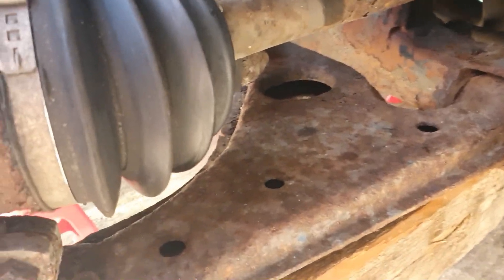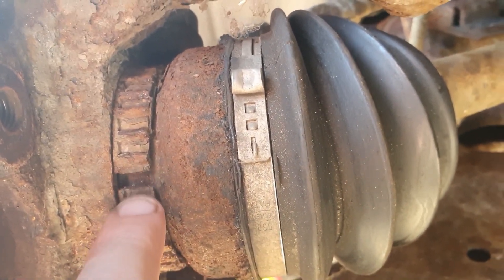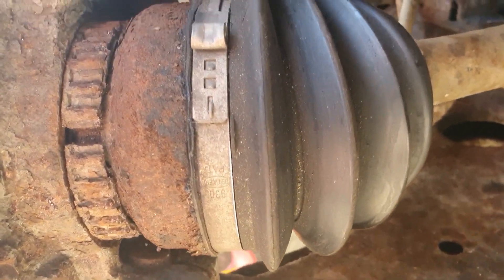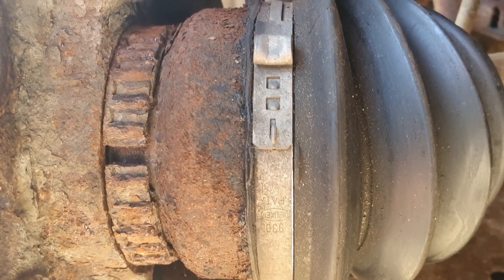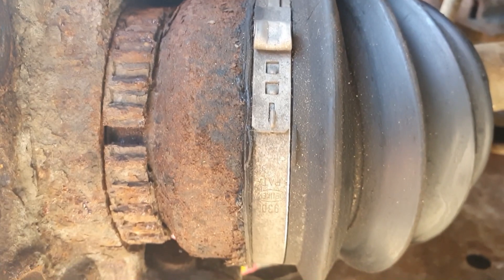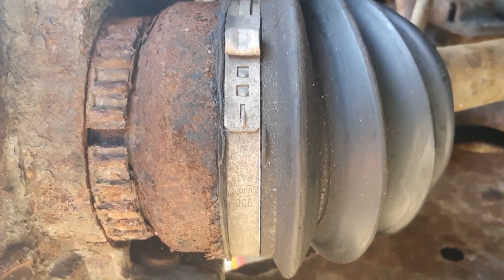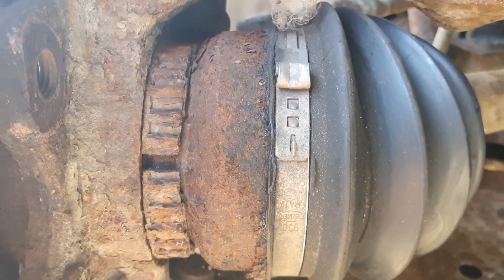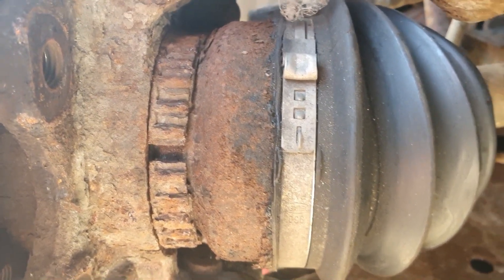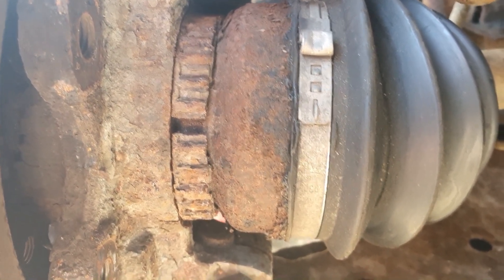I've just spotted another problem. If we look right in there, this ring here has got what looks like a bit of a cog. That's a wheel speed sensor — it detects those cog-like teeth as the wheel rotates, and that's used for the anti-lock braking system, so it knows if this wheel slows down or speeds up compared to the other one. I did have this problem on the other side about four years ago when the ABS light would come on every now and again because one of the rings had split.